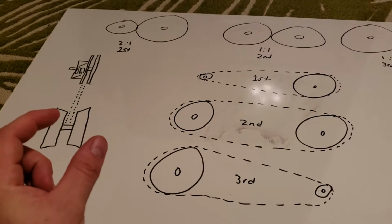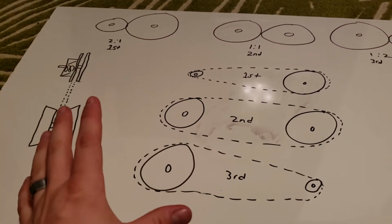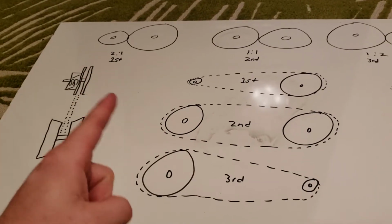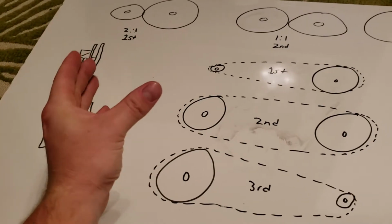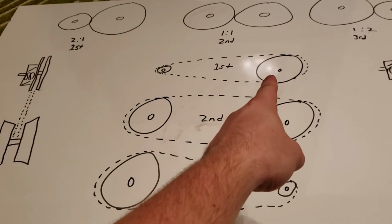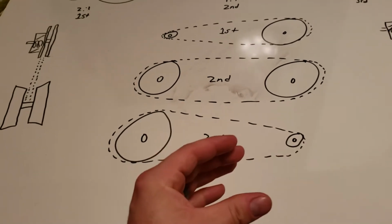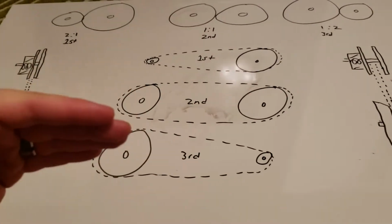That is going to have a tendency where when you are sitting at 0 miles per hour, or as you're driving and you go up a hill and it feels an extra load, as the RPMs slow down, this is going to want to naturally contract quicker, making itself bigger, making the belt want to go around a bigger pulley rather than staying in a lower, smaller gear when that load is increased, either going uphill or in acceleration.